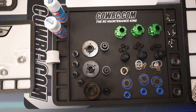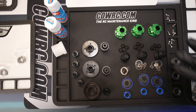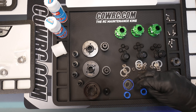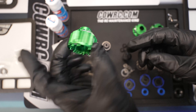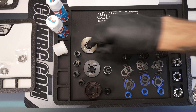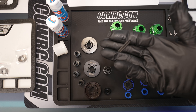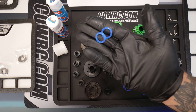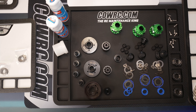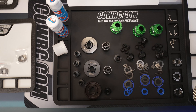This is going to be a complete rebuild all the way down to the center differential. We got the GPM 7075 aluminum diff cases, Mod 1.6 diff gears, GPM out drives, all the spider gears, sun gears, pins, cross pins - all medium steel. Brand new seals, all the hardware, and the truck is getting special treatment with Avid bearings throughout. We got them built and ready to install into the chassis.